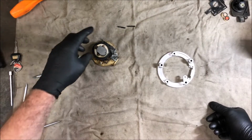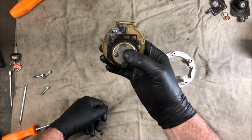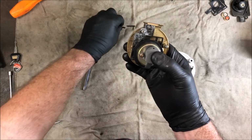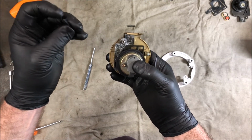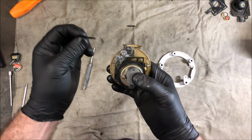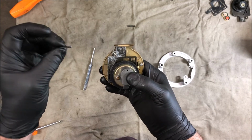When I was trying to pull this apart, I had assumed, I know I've had these apart before, but a long time ago, that the pin that goes through here was one long pin. And I was trying to punch it out, and it wouldn't punch out. I was getting really frustrated. So I eventually went and I was trying to use this punch, which is sort of the second smallest punch I've got. I got the smallest punch I've got and tried punching it in, and then it went in, but it went inside the roll pin here that secures it, and it got stuck in the roll pin. So then I had to try and pull the punch out of the roll pin, and much to my surprise, the roll pin pulled out of the cap. And when I got one out, I realised that it was two halves of a roll pin in from either side, not one long pin holding it in. So through a mistake, I worked it out, which is pretty cool. Always a good way to do it.